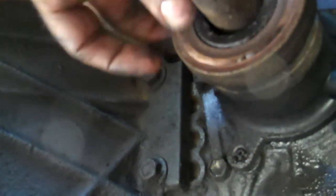See these straps right here — those come on the replacement ones. The strap holds everything compressed when you put it in. When you press on the pedal, it pops these straps loose so you don't have to hold all that stuff together. Now remember the crank position sensor up top — see these little notches in this ring? It reads these notches as it comes around. Each time it hits one of those gaps, it's a magnetic sensor that creates an electrical pulse and tells the computer where the rotation of the crank is.